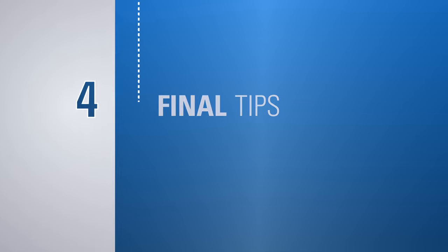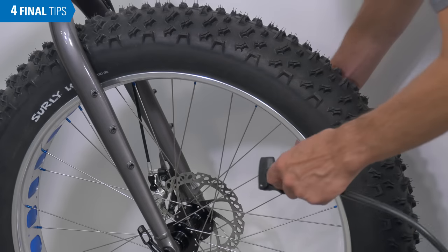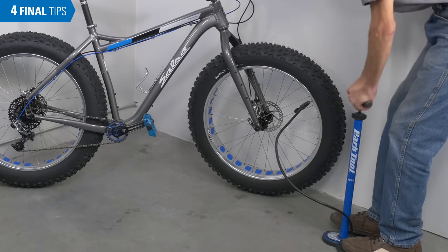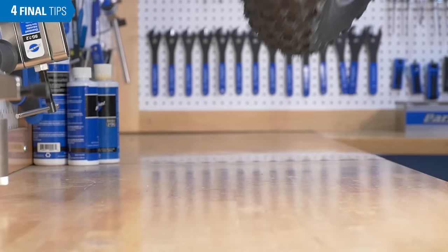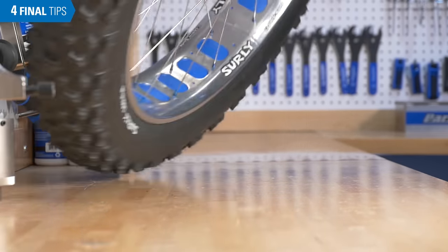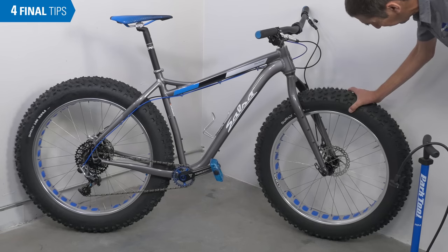Here are some final tips on use of tubeless fat tires. Maintain your pressure to at least minimum levels. In the tubeless tire system, some bleeding of pressure is considered normal and acceptable, which is why checking your air pressure is often important. Even though the big advantage of tubeless systems is riding at lower air pressures, there are instances where the system can fail. The worst load is the lateral impact — the impact may cause what is called a burp, where the tire bead opens just for an instant, allowing some air to escape. The pressure is now lower, and for every burp you are more and more susceptible to getting a complete flat tire. So check and maintain your pressure, and keep track of what pressure has been working for you.